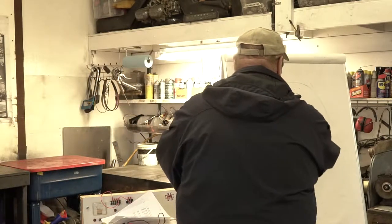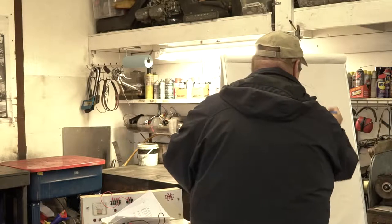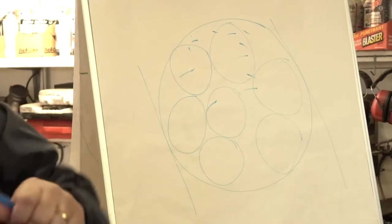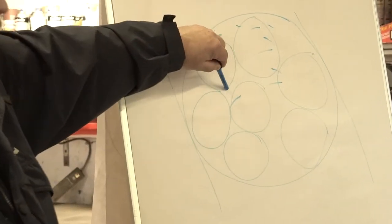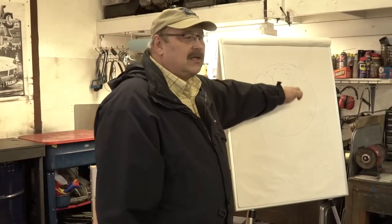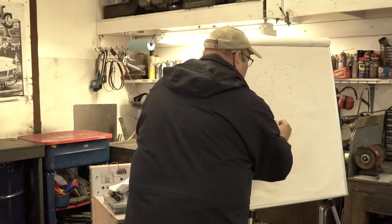What we get nowadays when you go to AutoZone and get one of those cheap battery cables, or buy a modern one from a supplier, instead of a hundred strands of fine wire you might get seven strands of coarse wire. Your new battery cables don't flex like the old ones — they're stiffer than stiff. It'll still measure that gauge, but look at all the air space in between that's not conducting electricity. There's less copper in the new wires a lot of times. You really have to watch it.